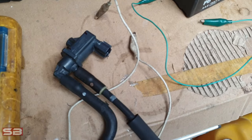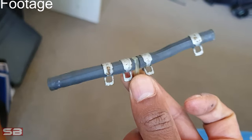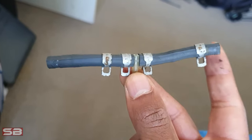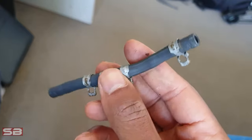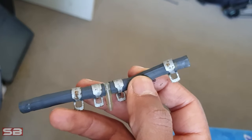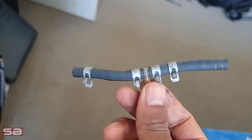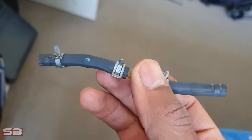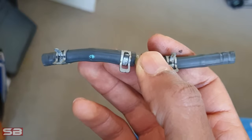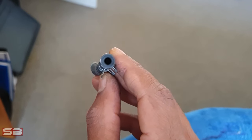Thanks for watching, I hope that was of some help. For anyone who might be curious to know, this is the boost line — or vacuum line — that runs between your turbo compressor housing and your wastegate. This is the T-junction that goes straight off to your boost controller. There is a restrictor pill in here, and if you get this the wrong way around you will inevitably have low boost. Subaru actually marks the restrictor pill side, so put a light up inside the pipe and you will notice it.